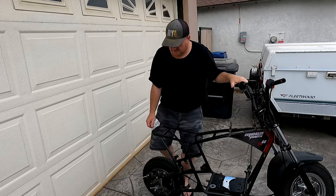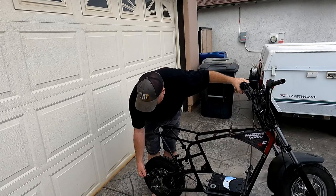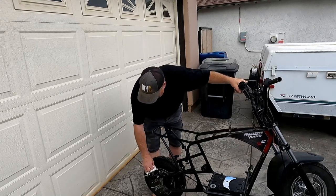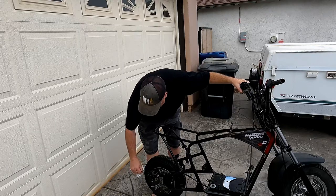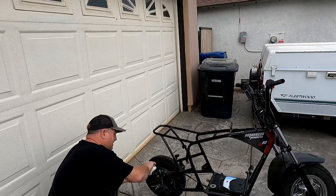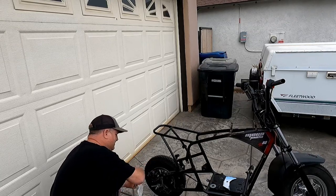Let's try it one more time. Use the handle — hold it. Good squirt. Use the handle again — oh, it's getting firm. Hold it, squeeze it. That handle is firm, man. This thing is going to have to stop. Won't have the same problems I had before. And I'm also going to clean all the brake fluid off — probably use some brake cleaner, just spray out the rotor 'cause I got some on it. Cap back on. I'm happy with that. I'm really happy with that.